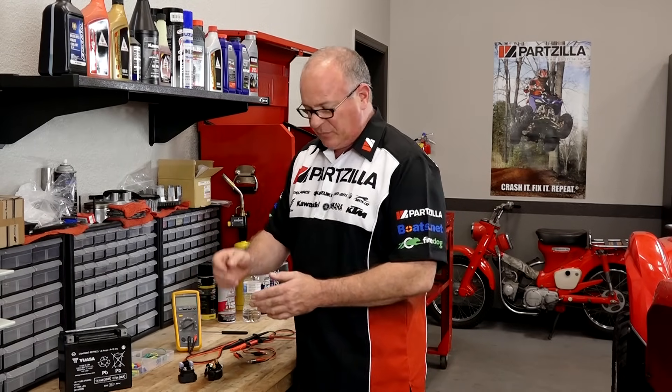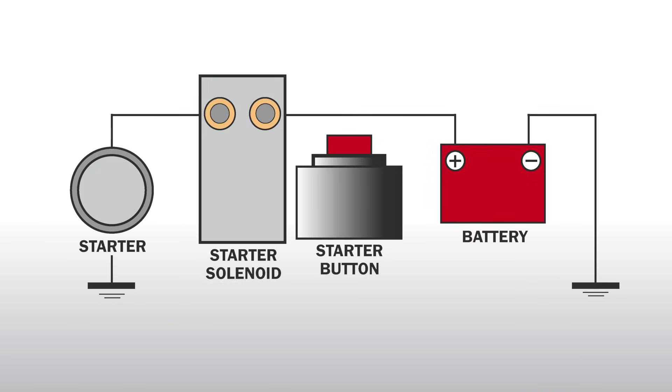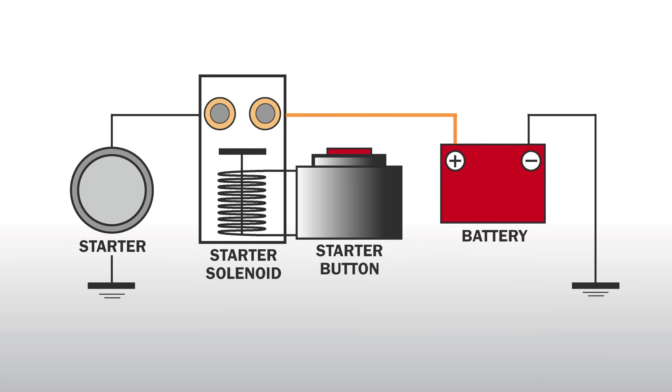Let me explain that a little bit better. Basically think of it as an electrical switch where you've got a low current device, like your starter button that's on your handlebar, making a contact point in between your battery and your starter. How do they actually do that? Well, inside here there is a set of windings that are going around an electromechanical circuit. And when they activate this using the low current side, it pulls up the contactor. In essence, it connects these two points together, taking your battery side and switching it over to your load, which in this case is going to be a starter.